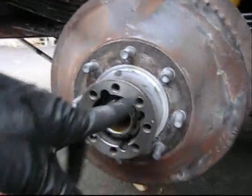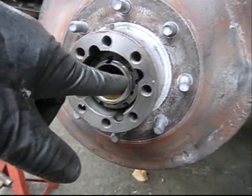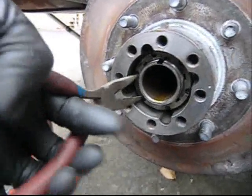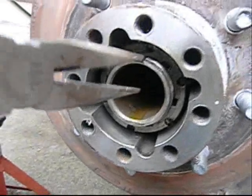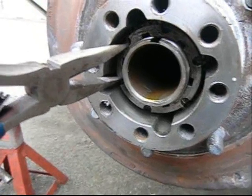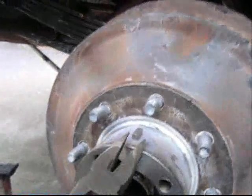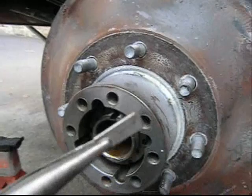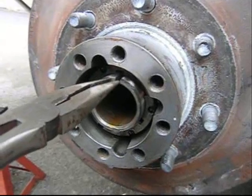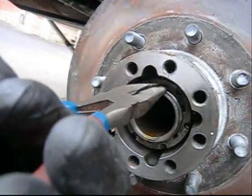Anyhow, so I put the drum on and I tightened the inside nut, and there's no washer. It's kind of odd. Tightened it right down tight. And then I had to back it off a little bit because that's the way it works. There's tight right there, and there's where you put the loose Woodruff key, and it goes into that slot. They mate. So I got to go backwards to the next slot. Unlike the ball joints where you never back off, this one you back off. You take the loose Woodruff key that I've stored right here. Hard to believe, huh? Just a square key. Nothing to hold it, nothing to stop it, no springs, no nothing. And you slide it in place, right like that.